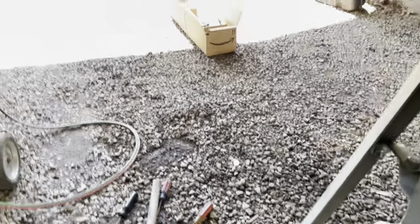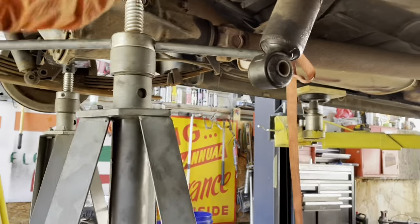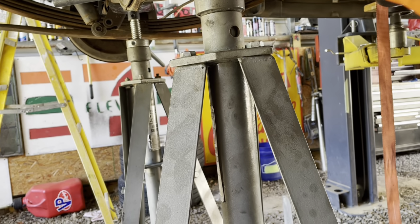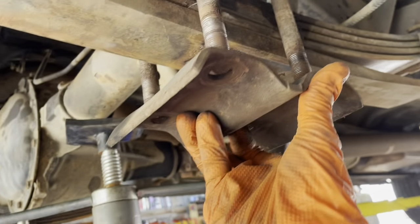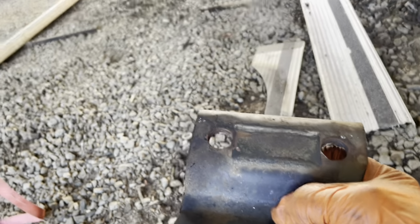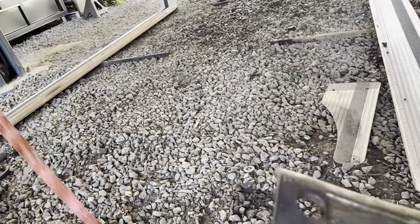Maybe you had time to cool down. And then you take your factory plates, put them right back in place. Now, this will be off-centered just a little bit. A lot of times we'll just go ahead and drill an extra hole, a relocation hole right here, or you can slide it forward just enough to let your pin sit right in this valley. Either way, it'll work.